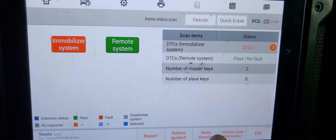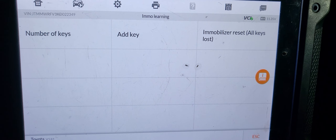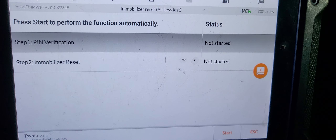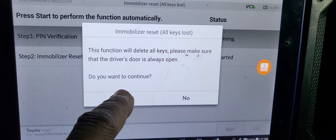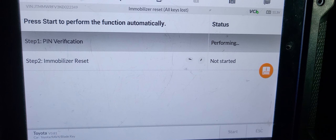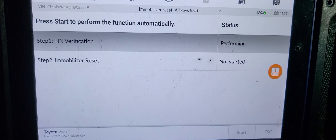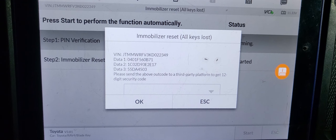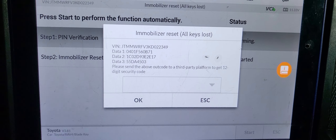We brought our Maxi 6. Now I'm going to try to connect. Accept, then go by VIN - auto-detect the VIN. Let's see what happens. They need the door to be open. When I open the door, the interior light is supposed to come on, right? The interior light is not coming on - maybe that's why.